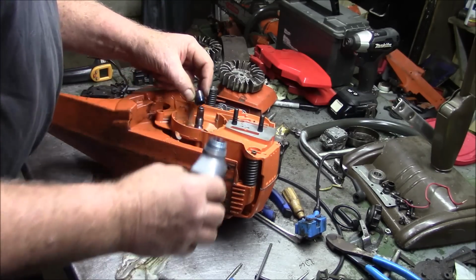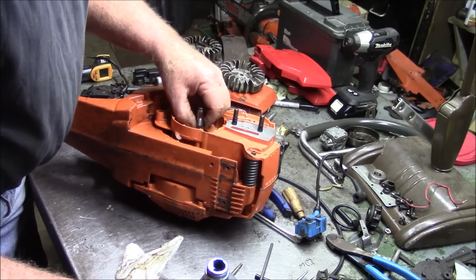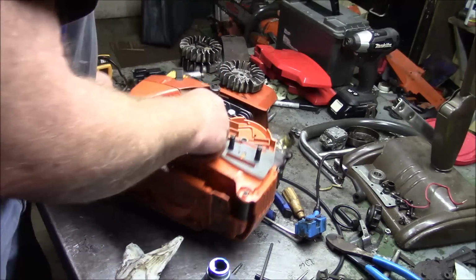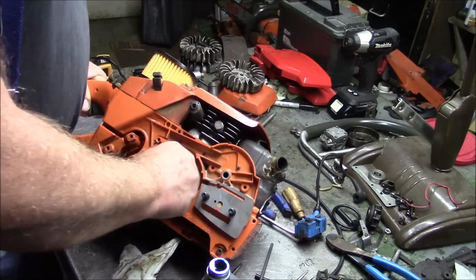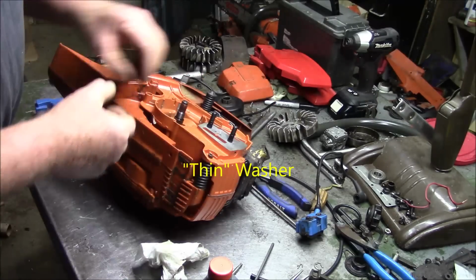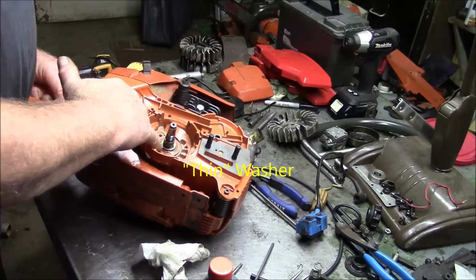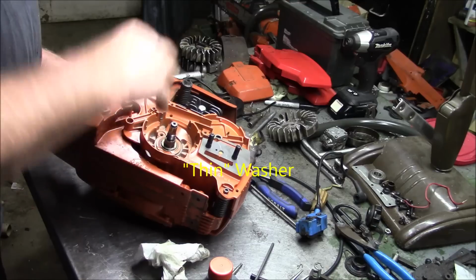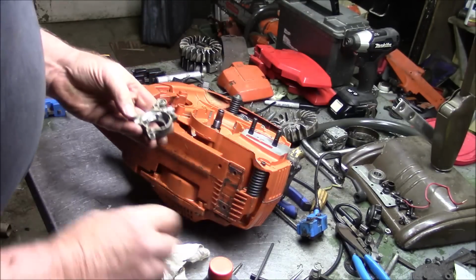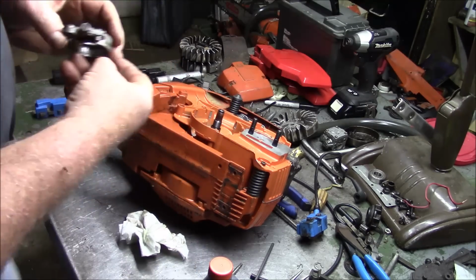I don't like putting anything in there dry. So I got the little O-ring in there, right? Now I'm going to put that bushing, push that down inside. Okay. That goes right there. You see how that sits at the edge of that sleeve and won't let the worm gear work its way back into the seal. Next on the stack is the oil pump.